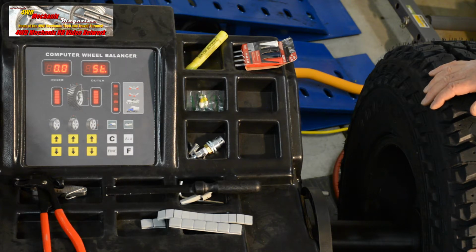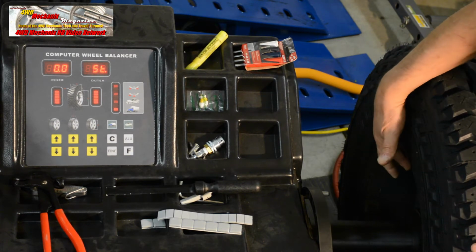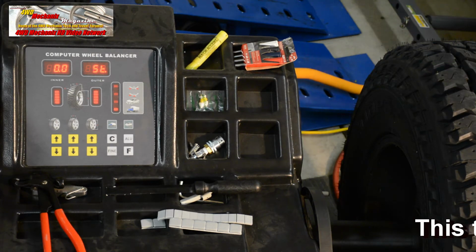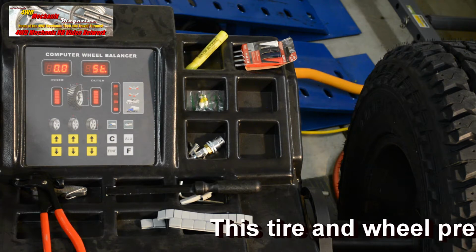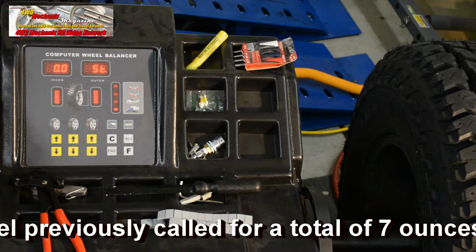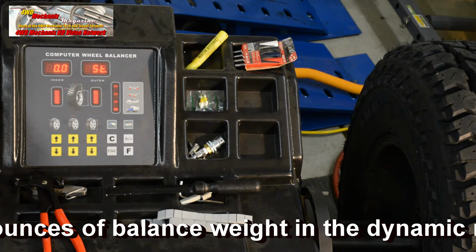Since this is our shop and our tires, we can try 1 ounce of weight placed at 12 o'clock on the midline or center line of the rim. We'll make note of where this tire goes in position on the vehicle and exactly how it reacts. One tip-off that this may be accurate is that the tire has no tendency to fall one direction or the other and is assuming almost a near perfect balance.